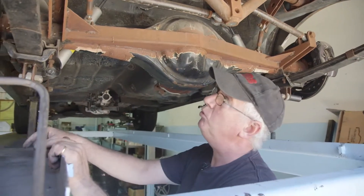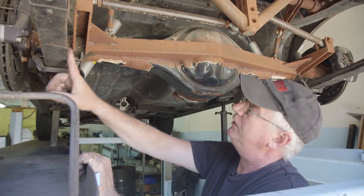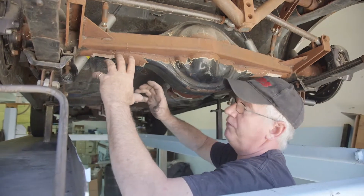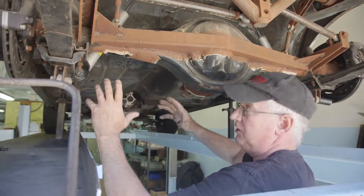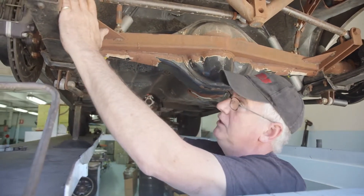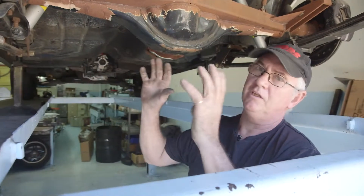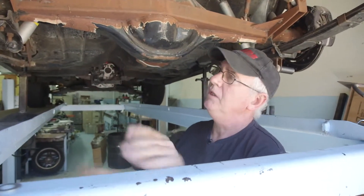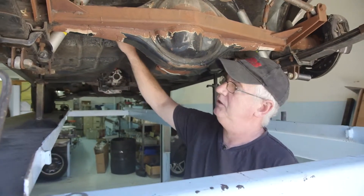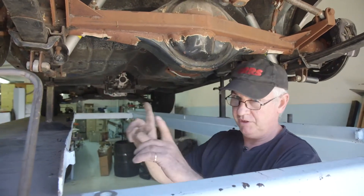There's only one worse type of suspension for doing that, and that's a triangulated rear end. Triangulated rear ends, because of the short upper arms and the angle of them, produce more roll of the diff, which in turn turns the diff. So leaf sprung rear ends and triangulated rear ends, if you're a performance cornering person, are not the go. There are a lot of other manufacturers whose design approaches the triangulated rear end. The shortcomings: one is roll understeer, the other is the upper arms that transfer the torque into the chassis put it into the chassis in the wrong spot.